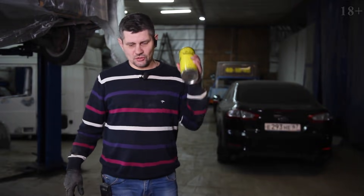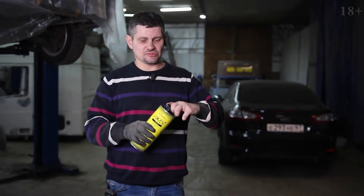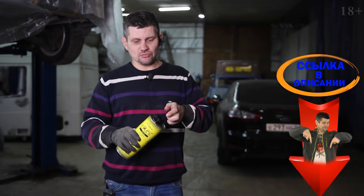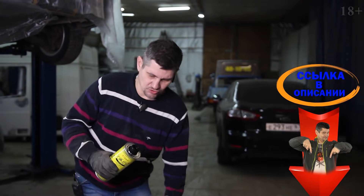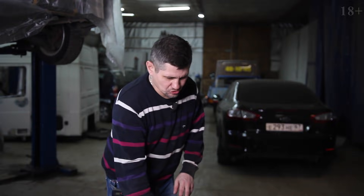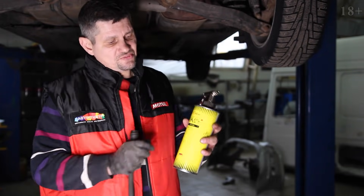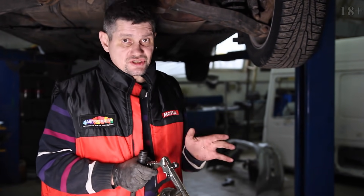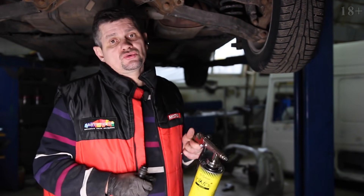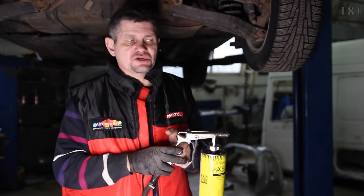The mastic is already ready to use — no dilution is needed. You can warm it up if you want so it flows more easily. There's a small cap on it, so if you haven't used it all, you can close it again after work — very convenient, because everyone is used to constantly re-sealing anti-gravel, all that hassle. We've already invented the wheel here. And the whole point of this composition is that if you haven't completely removed the rust — for example, if you didn't sandblast — the inhibitor composition will hold that rust, transform some of it, and simply contain the rest. It essentially saves you from extra work.